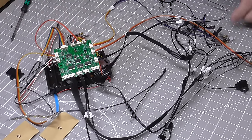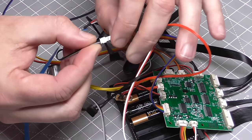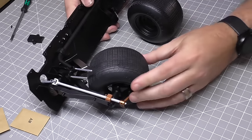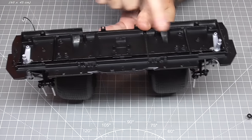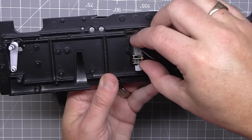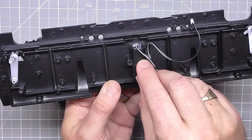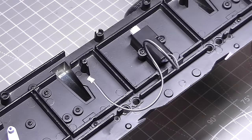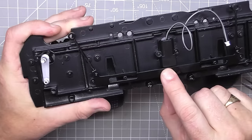Now on this massive wiring loom we're going to need to take the motor which is motor number two. If you look at the rainbow part of the wiring loom, number two is just here — so let's get that detached. This is the front end of the tumbler. In this middle section, that's where the motor is going to go, sitting in just like that. I've then got a case to put on which is going to go underneath to hold all of this into place, held in with AM screws. When that's in, it should look just like that.